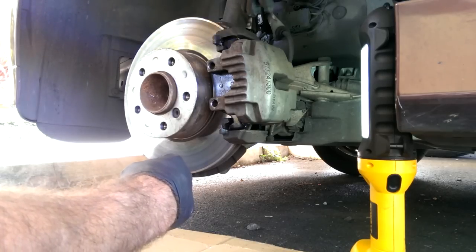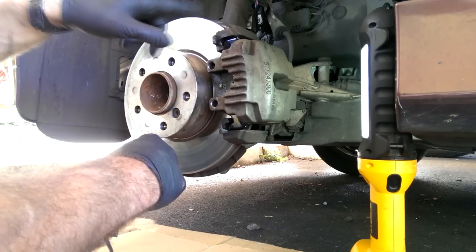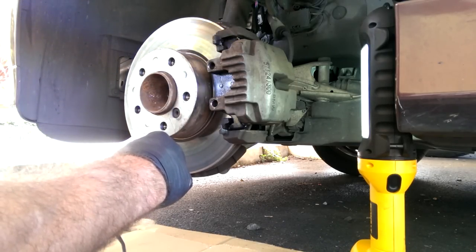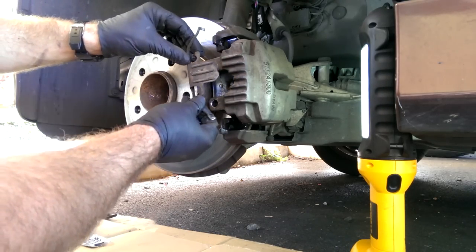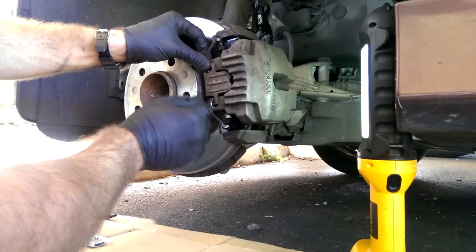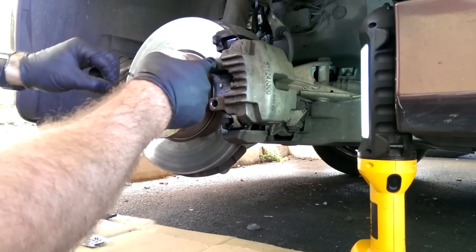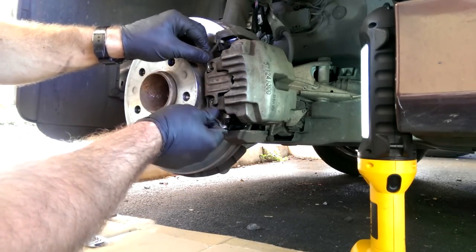So we've got our pads in place. Everything is still lubed up from before. I even took some of the extra lube off. Got our two caliper mount bolts in, and now this thing pops into these holes here. And you got to make sure that these hooks, actually there's a recess back up in here, you got to make sure they get up under that recess.